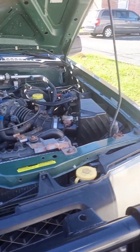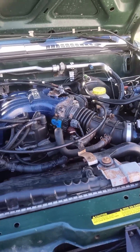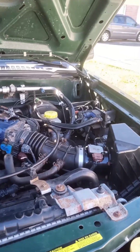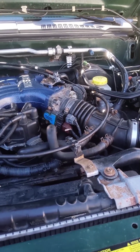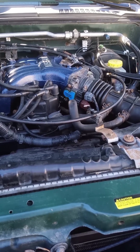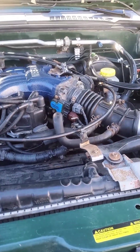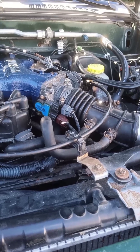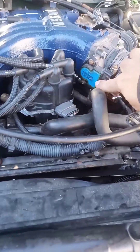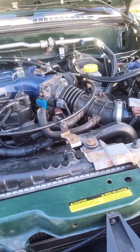Also, when I was driving this thing — the one time I did drive it — I had some shifting issues. It didn't want to shift. It would rev really high and then hard shift into some gears. So if you're experiencing anything like that, this may be your culprit. You can test for it before you just go and buy one, although they're not too expensive. Most people on the forums do recommend Hitachi. I think I have an aftermarket one.